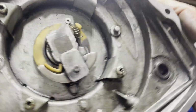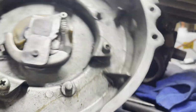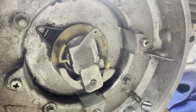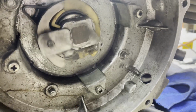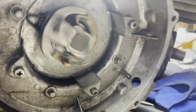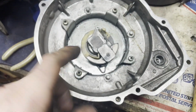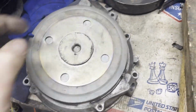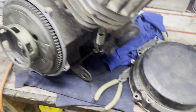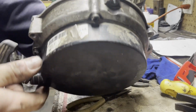Yeah, this isn't probably the best way to do it here. I'm not quite left-handed. Like that there. Then from there, put everything back together, tighten it down, get your rope on, get your cover, feed it through, wind it up, get good tension on it, and then assemble it back on the engine. You should be good. And just like that, we now have a working rewind.